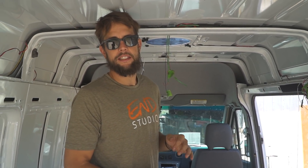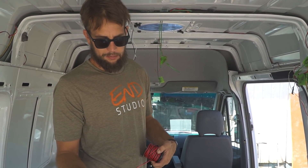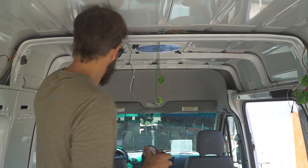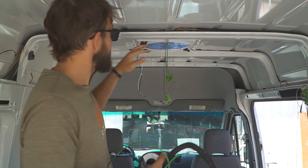We've made quite a bit of progress — we've wired a majority of the appliances and lights. We used 18 AWG red and black combined wire for the lights and all the low voltage stuff like USB chargers. For the more high-powered items like the fans, sink pumps, and fridge, we used 14 AWG stranded wire. I always do stranded wire for the van. We also used a lot of corrugated plastic conduit — some of it was already in the van so we got to reuse it.